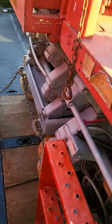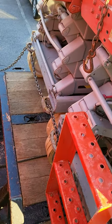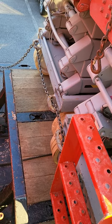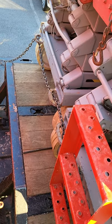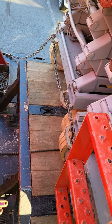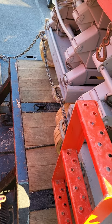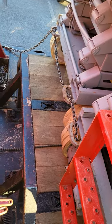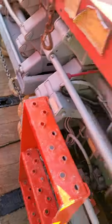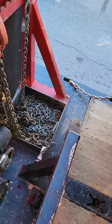I'm going to put two of these 32-foot scissor lifts side by side on a Century 30 series bed. The bed is approximately eight feet four inches wide, probably eight and a half feet wide, so you can get two 32-foot scissor lifts on this bed no problem. I'm only going to run one chain in the front, one chain in the back — one 10-foot chain with one hook to the chain holes on my carrier.